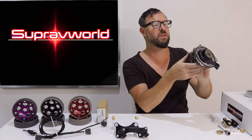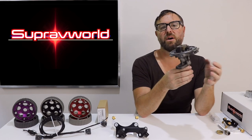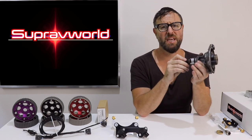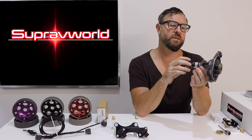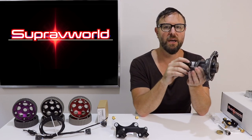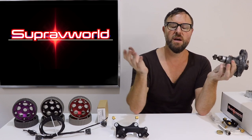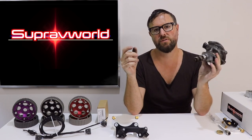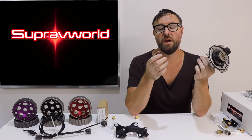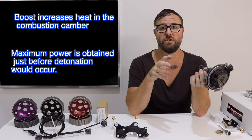The worst thing is you've then got an adjustment screw that sits on here, and this can turn up and down. Now you set this by using a timing light. So effectively you can use this as your base timing, but the accuracy is absolute rubbish, if I'm being honest. So you can set this with a timing light, but you're not going to set the timing light at 6500 rpm or anything high. You set it down low. As soon as the engine is under load, you've got belt stretch for a rubber belt, you've got vibration from the cams. There's a lot of moving parts going on there. This is not fixed to the crankshaft, and it is certainly not accurate. But to control your naturally aspirated 2JZ, that's fine, it's going to do the job. But as soon as you turbocharge your naturally aspirated engine, you need a very precise way of timing the engine - and this is not it.